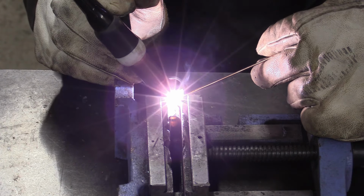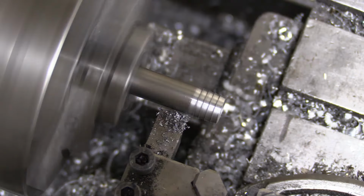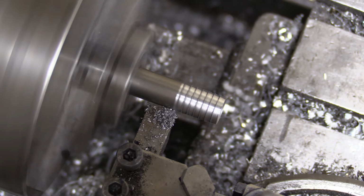The last thing we need is for the intense heat of the turbo to melt the water hoses. So we're making the tube that's closest to the turbo out of steel and bringing the end where the water pipes fit down away from the heat.